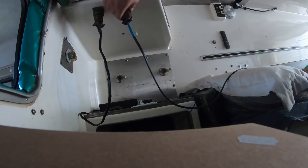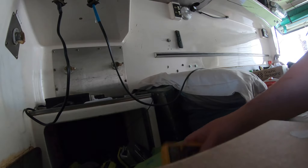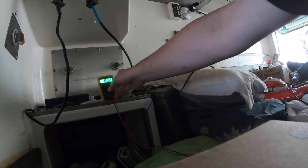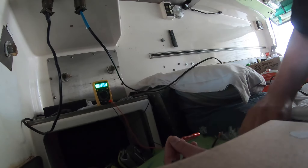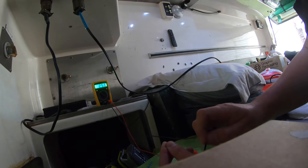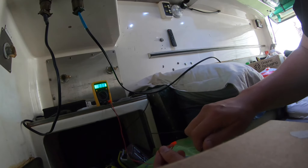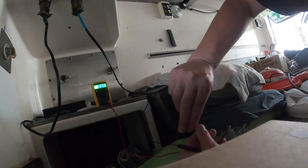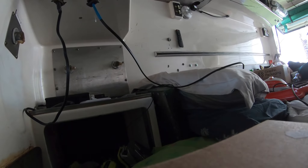We'll see what's going on here. Let's wind our multimeter up to the 200-volt range, stick the backlight on, and plunk it up here. Take a positive terminal there. Master interior on - there we go. We have 24 volts, correct polarity. Let's swap this just to make sure I'm reading the meter correctly - that is indeed negative polarity, which is what we would expect. And a bit of a tingle from my fingers on 24 volts because it is starting to exceed the voltage at which you can perceive it.